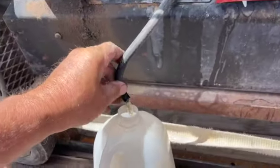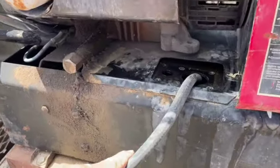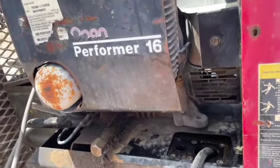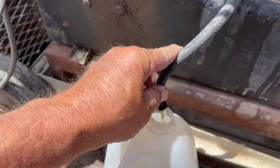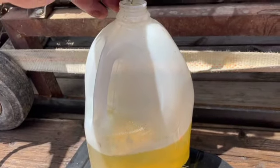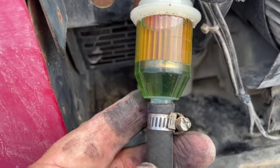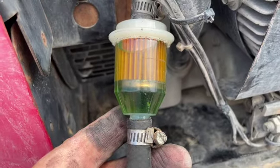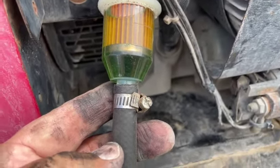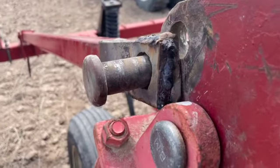Here's where we find ourselves right now — that doesn't look like gas. We're draining this tank because I got everything running but it just will not run. I'm pretty sure the float's probably stuck in there too. We're gonna do a little cleaning up, see if we can get this old gas out and get some clean gas in. We've drained out about nine and a half gallons — we think it's a 10-gallon tank. We're going to drain the rest out, put in some good clean gas, and give it a shot.